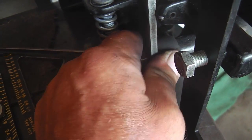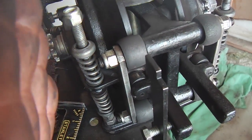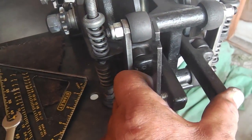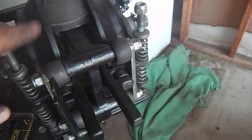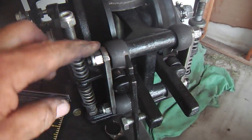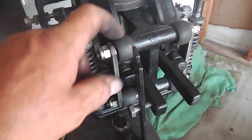I can actually get a little bit of rotation on that one now that I play with it, but on this one especially, this one's loose. All the adjustments are proper, and I got 50 thousandths measured on this side as well. But these bushings are just looser. These things are almost 25 years old, and on the one side, the tension is good, quite good. But this side seems a little sloppy, so I'm going to put a washer behind this one for sure, maybe even down below here, just to pucker that up a little better.